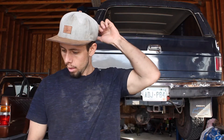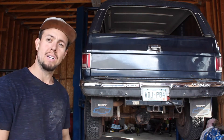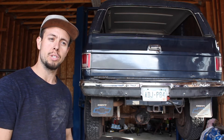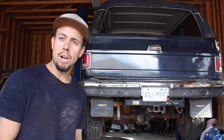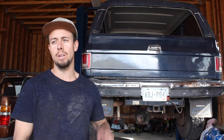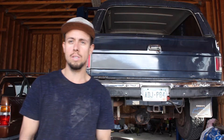Here's the plan for today - this truck has a lot of work being done to it right now, but for this video the focus is going to be doing a five-speed swap. This is a 1984 Chevy K5 Blazer with an SM465 manual transmission already in it, and it's a manual linkage clutch. I've got a five-speed, an earlier version of an NV3500, pulled from a 1989 GMC truck with about 150,000 miles on it. We'll see if it works once I get it in there.